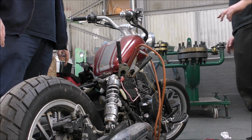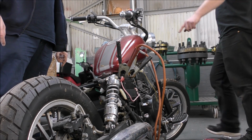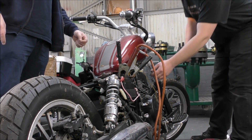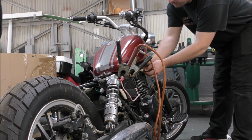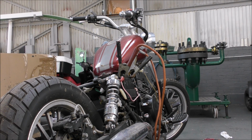Oh look! Are the coils live and all that sort of stuff? Do we have a spark, etc.? So I want to grab a rubbish spark plug, just pop one of them off. Make sure we've got spark. Okay. Then we can turn fuel on, and we might have fire starting inside the engine.